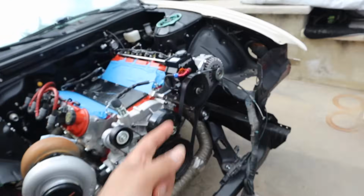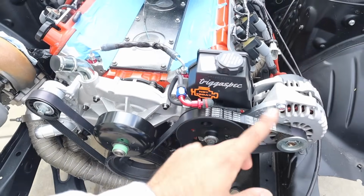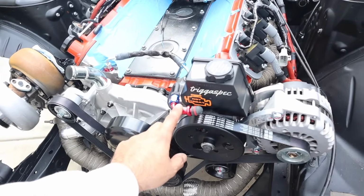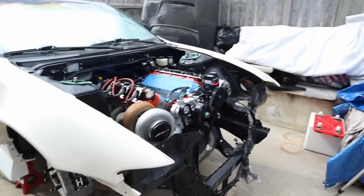and you can run Dexron VI or any Dexron power steering or automatic transmission fluid through it. Otherwise, if you try to use a normal fuel hose, the power steering fluid has a material in it that will eat through the hose. So do not cheap out on this stuff, because you want to do the right stuff. But yeah, we got all this, so now we can start getting it on.